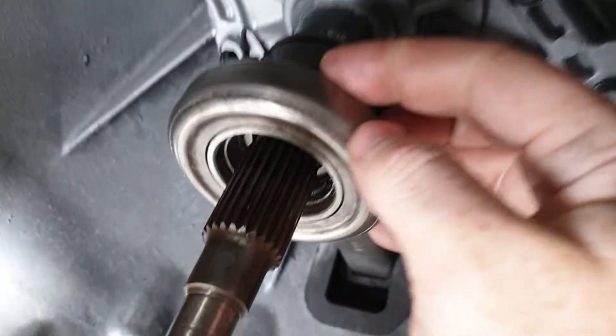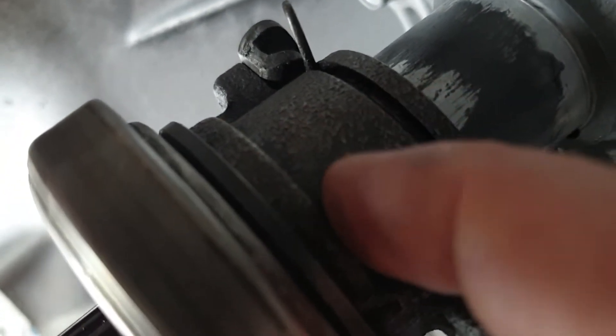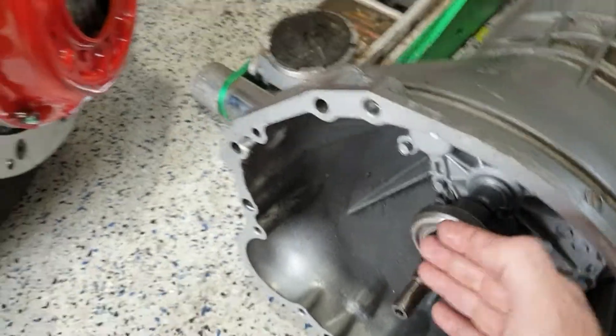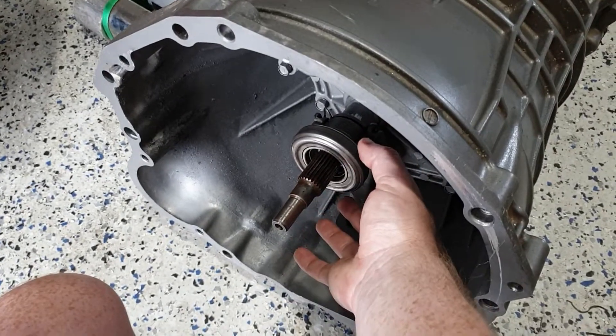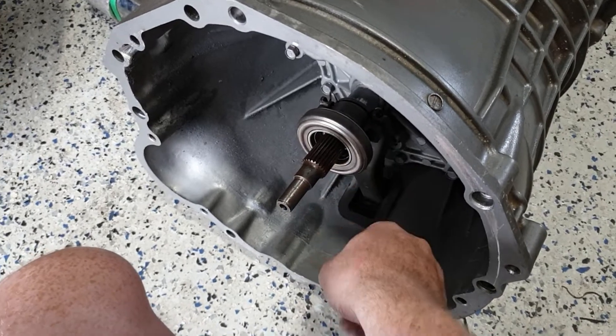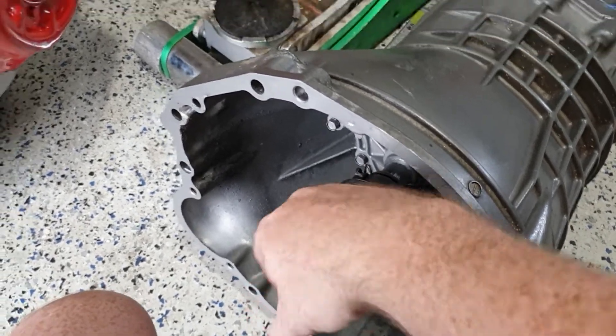One handy thing — there is a metal spacer piece here. Normally this bush is fully against the cast section for the throw-out bearing, but they've supplied a spacer to try and make up some of the distance. Since the gearbox is moved back 10mm, this tries to bring the throw-out bearing a bit further forward for better pedal engagement. Yet to have this in the car to test it, but I like the idea in theory.